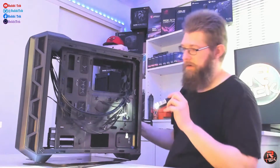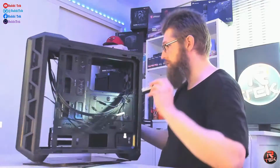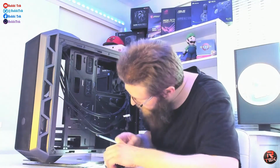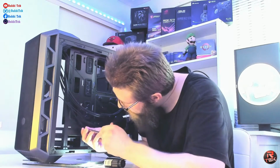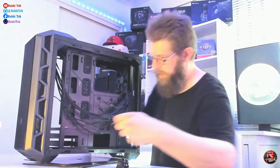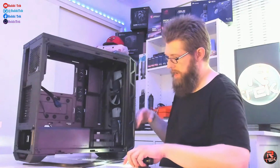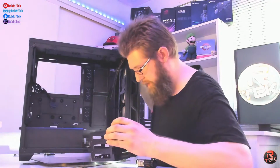which means we may be able to stack the hard drives themselves, which we'll need to remove that to get it flush to be able to stack it. But before we do that, I'll see if we can stack it by removing the bottom one, which is on this side holding the hard drives in stably, and we'll get a better idea later on whether. Okay, so pop this screw over here, and now this should just pull out accordingly.